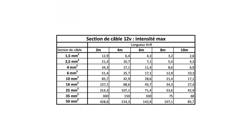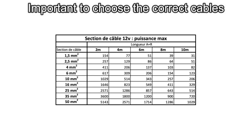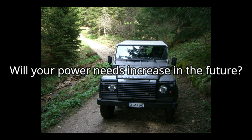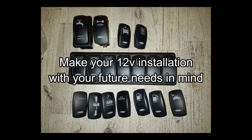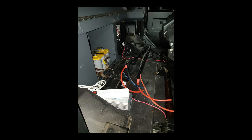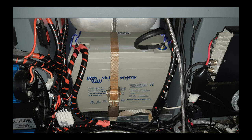The second most important thing when starting a 12 volt installation is to make a good diagram and choose the correct cable sizes based on the length you want. If you know from the start that you will never need a bigger installation and that your power needs won't increase, you can settle for a minimal setup. On the other hand, if you know that in the future your power needs are likely to increase, we recommend you already choose larger size cables — this will have the advantage of not having to redo everything when your needs increase.